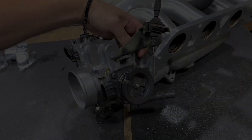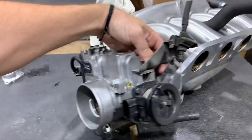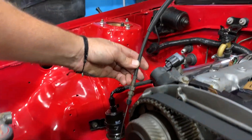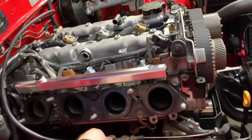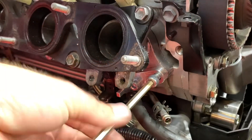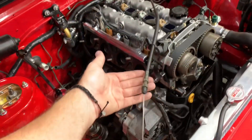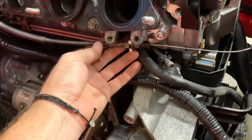The throttle cable on the Altezza connects to the top of the throttle body and points upward. This can be a problem in an AE86 chassis because the engine sits much closer to the hood — the cable would end up getting kinked as you close the hood on it. So instead, we're going to route the cable under the intake manifold using a JSP throttle cable bracket. The throttle cable bracket is a billet part with a simple design, and it mounts to the lower intake manifold. The cable can then route over the back side of the engine, underneath the intake manifold, and attach onto the bracket.